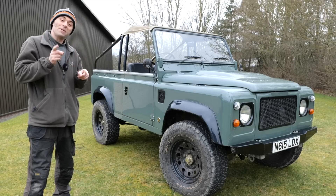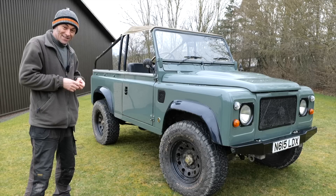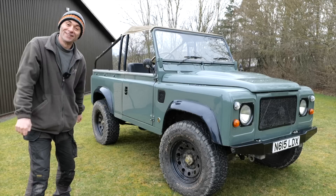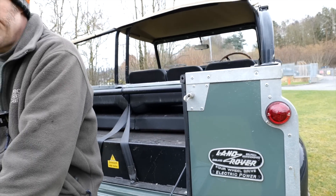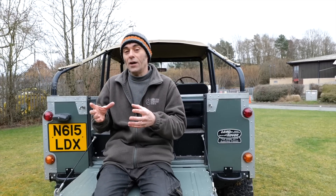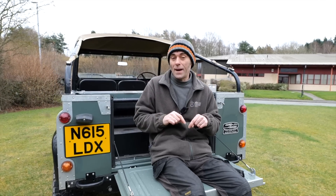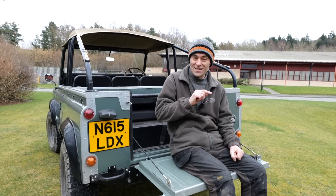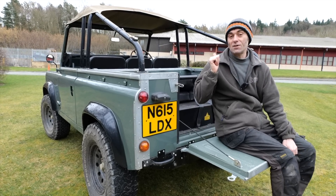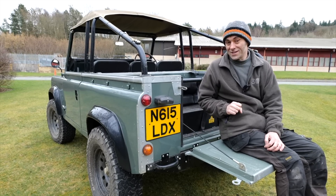Not the first time? Nope, and it won't be the last either, because what I've done — I've taken my already ridiculously quick Land Rover Defender and I've upgraded it. So hopefully in this video we're going to see if this is the fastest Land Rover Defender in the world. I'm going to start by giving you a quick summary of what I've done. I've put a 100 kWh battery pack in this out of a Tesla, taken the Tesla drivetrain and put that in the vehicle as well, with a bit of jiggery-pokery to fit it in, and we've got CCS rapid charging on this as well. But you want to know what I've done more recently, so let's get into that.